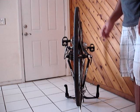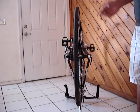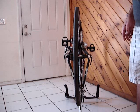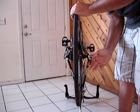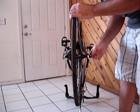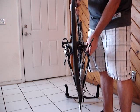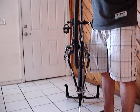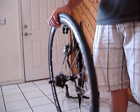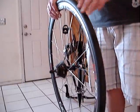Real simple to start — you could have a bike stand, I don't have one yet, so what I've done is just simply flip my bike over so it's nice and easy to work on. First thing we want to do is go ahead and undo the quick release hub. If not, you'll have to unscrew a bolt. Loosen it about three turns, then pull it straight up and out, take the chain off the gearing, and you have your wheel off the bike. Now it's time to start changing the tire itself.